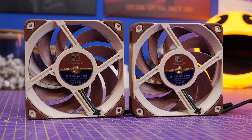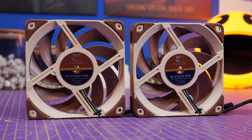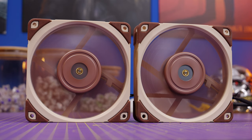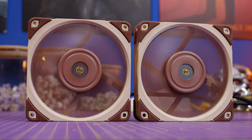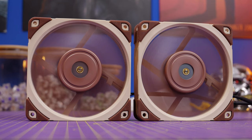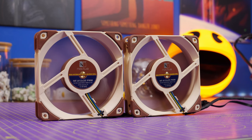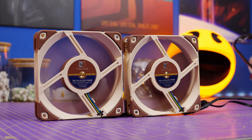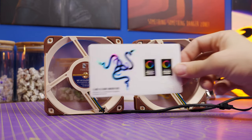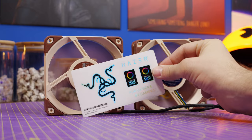You obviously have an airflow logic to fans where they suck air from one direction and push it in another. The usual case — and this is 99.99% of fan setups — is that the airflow is simply from front to back, so the front of the fan pulls the air through and then it's pushed out of the back. So if you're trying to suck air, you need to put it so that the front faces the direction you want to suck it from and the rear blows out.